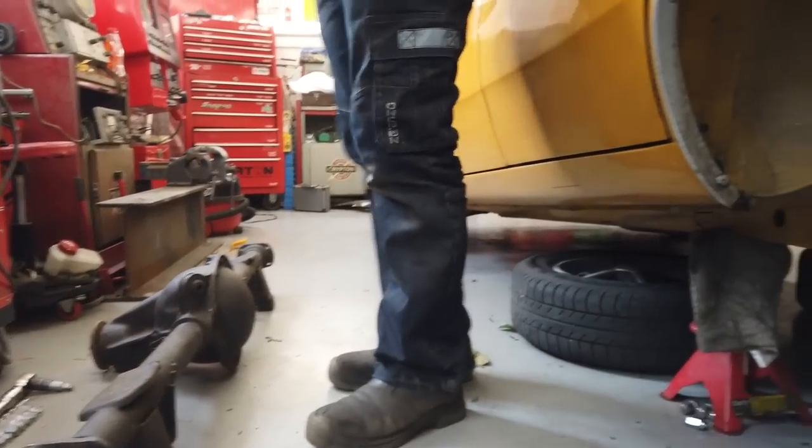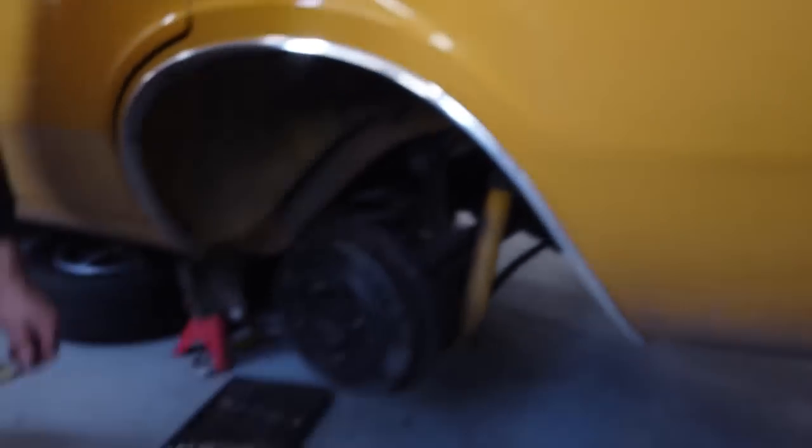We've also got a secondary fault, and that is the fuel sender. And this will happen on your Mark IIIs eventually. The pipe on the fuel sender has fractured on the solder join. I don't know if you can see it here, but on the solder join, we've now got a petrol leak as well. So we've got a fuel sender, braze point has broke, or solder point's broke, axle has seized up, or it's on its way out. That's got to be replaced, so I'm going to leave Richard with it.